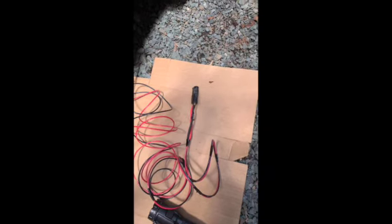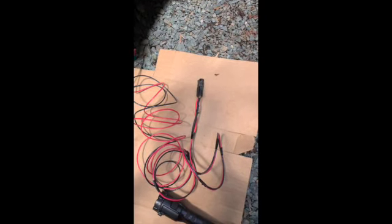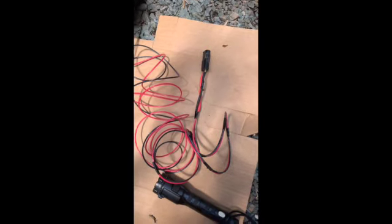I'm going to trash that control motor. I just clipped the connector off that goes to this step motor off of the relay switch so that it would fit properly, and then soldered on 2 wires I'm going to run back into the switch, and heat shrink those, and I'll show you what we got. So you can see here is where I've disconnected the step motor. This connection right here is what we'll be wiring to.